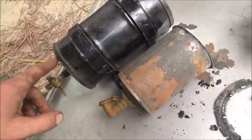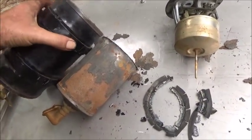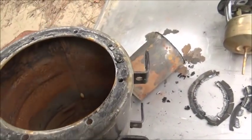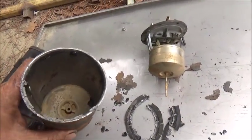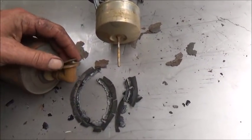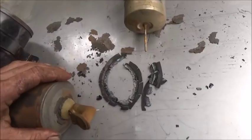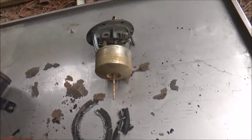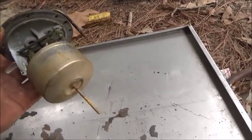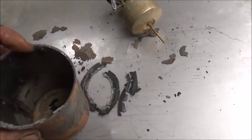What I'm going to do is clean this up and put it back down in here. With it shut off, I'm going to fill this whole thing full of Metal Rescue and let it sit and let it eat all the rust out of the inside from where this thing's been sitting. Get it really clean and then we'll put it back together and make a new cork gasket. This doesn't have rubber on it — I think it's a hard plastic, probably Bakelite — so it shouldn't hurt. Everything here is in pretty good shape, just needs cleaned up, so I think it should work out just fine.